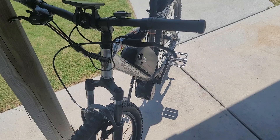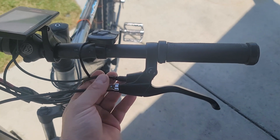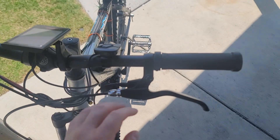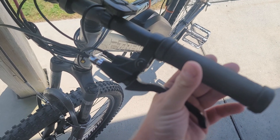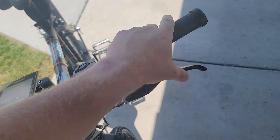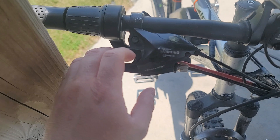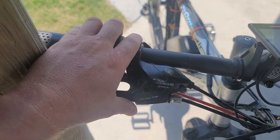I did replace the front brake with the brake that came in the Bafang kit. The reason I did that is because this one has the sensor in it — when you pull it in just a little bit, it kills power. It's kind of cool because it acts like a clutch. You can pull it in just a little bit, not enough to grab any brake, but enough to kill the power if you need to. However, you have to remember that if you ever want to just hit the rear brake, you have to at least pull this one in a little bit too or it's not going to cut any power. I couldn't swap this one out because the way this mechanism is made, the shift mech is in with the brake.